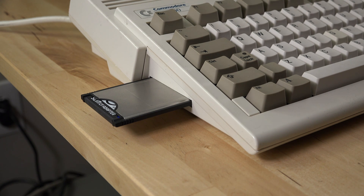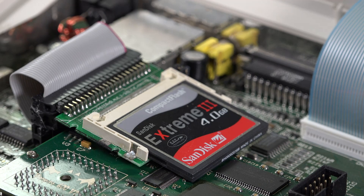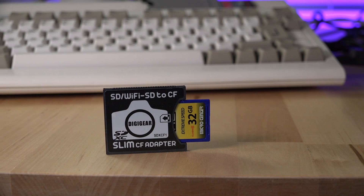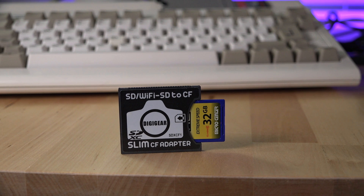These tests were performed with the cards used in the PCMCIA slot being formatted FAT32, and the cards tested on the internal IDE were fast file system. The Compact Flash cards were high-quality SanDisk and the SD cards were just cheap Class 10 cards from a local Micro Center. So depending on what cards you use and file system, your results may vary.